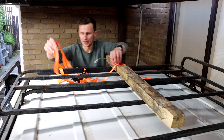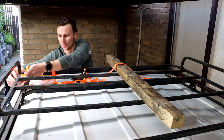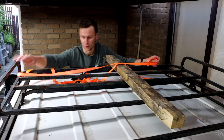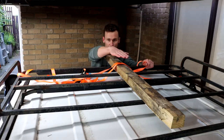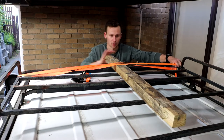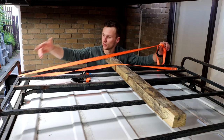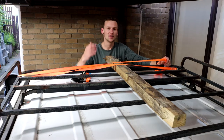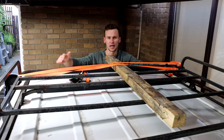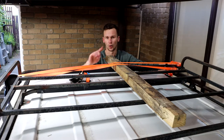With a lot of length being left over in this situation, I would wrap it around the roof rack like so, making sure I go through the bottom of it. If I go through the top, it's obviously going to come up higher than my piece of timber and not grab it. So going through the bottom, that's wrapping over it, and we've got less strap to tie off at the end. The more times you wrap your straps around something, though, the less tension they're going to have when you tighten it. So if I am going to wrap my strap around like that, I'm only going to do it a maximum of one time.